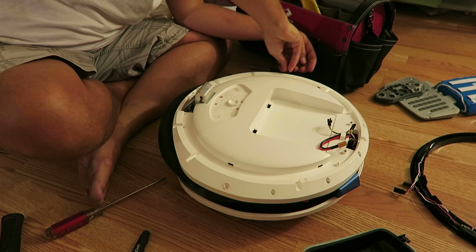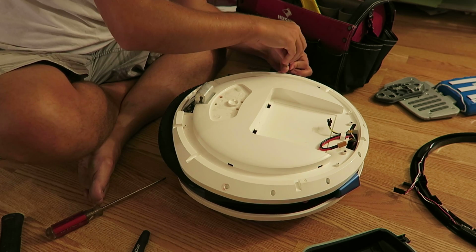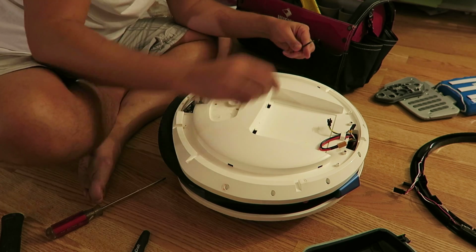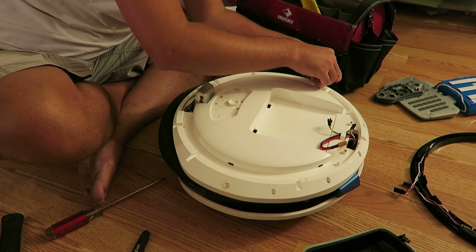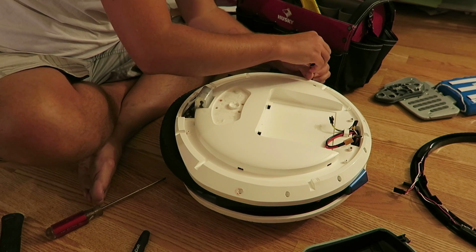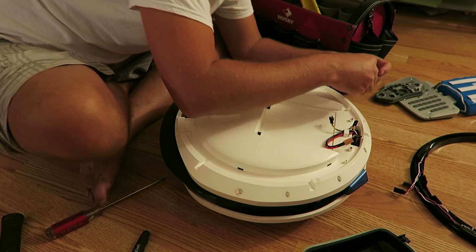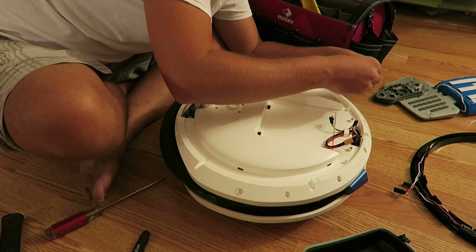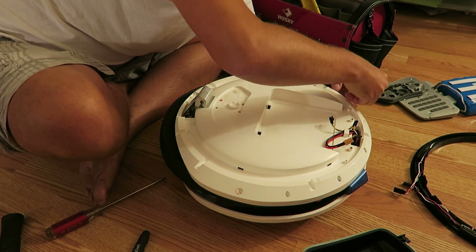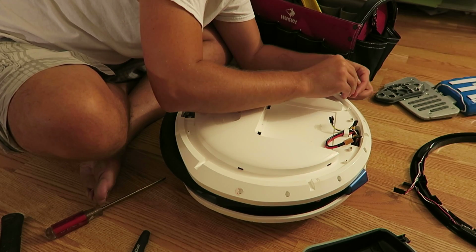And again, just like anything, I'm not ratcheting at this. I'm not throwing crazy pounds of torque at it. Just backing them off one by one. Okay. And we're going to try to follow that same procedure when we put everything back together. We're not looking to cross thread anything or hollow out the insert of these screws here. We don't want that.